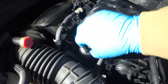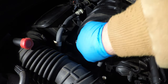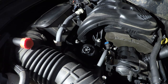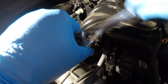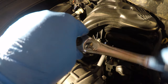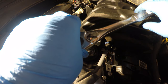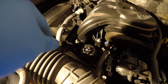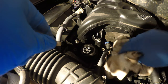Take our filter and stick it down into the housing. We're going to take our 5/16th socket and just snug it down very gently — it is plastic. Pretty much just until it stops. That's all I do, because it is a plastic housing and it could break. Wipe up any extra oil residue.